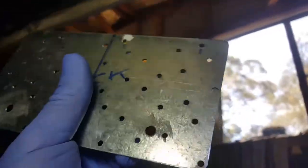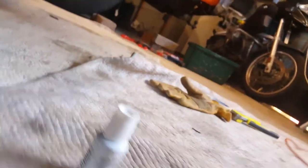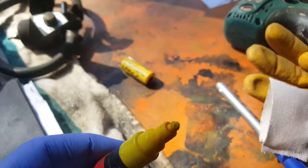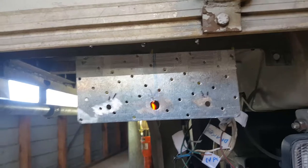Just make sure you've got this oriented the right way. I've lined it up with my mark in the middle and gone up and used white-out because my paint pen won't pass through that hole. Use a center punch to make a punch in the middle of that hole. You're going to need a brand new drill bit — or at least a good one — to drill through there. It's actually fairly difficult to get up under there. I used a vice grip to stop the bracket from moving while I got the left rivet in, then put the right one in.